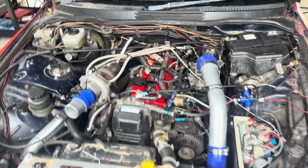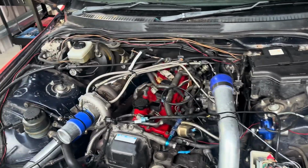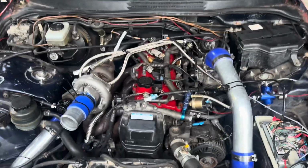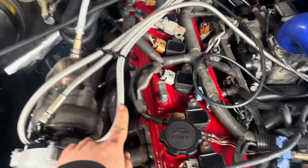Okay, so I have the ignition map okay, the VE map is not okay, it's very rich. We're going to pull fuel out of it. I got my cold start okay, my hot start is medium okay, not ideal, but we'll get that a bit better with the VE table tidied up. And got my water cooling done.